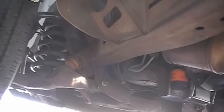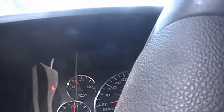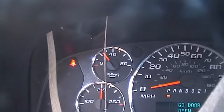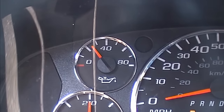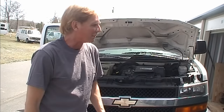Can you hear that tick? That's the lifters going bad. You can see we don't have a lot of oil pressure. We're going to try this Motor Medic motor flush, follow the directions, and just see what it does. I really don't know what the results will be, but we're going to give it a try. Hopefully it quiets it down a little bit. There's such a good-looking truck and we'd really hate to spend any more money on it.